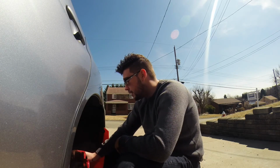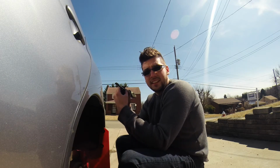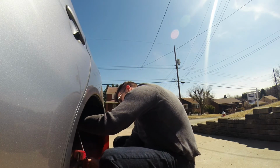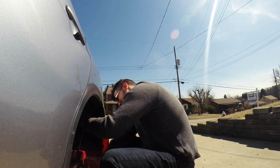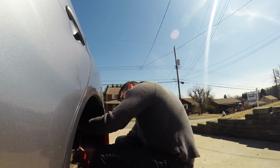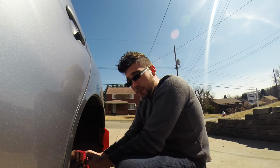I think it just needs a new bulb, really. Maybe it shorted out the bulb. It does come on for a second and turn off. I had a problem when I first did it, where they connected at the bulb, between the harness and the actual ballast itself. It was having an arcing issue there, making a horrible buzzing noise. I don't seem to be having a similar problem, but I took them apart, put dielectric in there, and put them back together, and it still doesn't come on. So either a bad defective ballast or something's wrong with the bulb. I was just going to replace the ballast and the bulb on that side, and I could diddle with it on the bench.